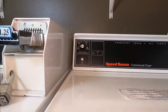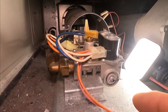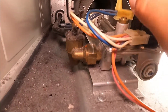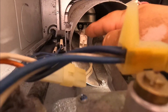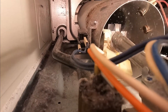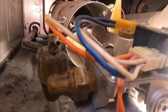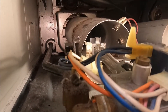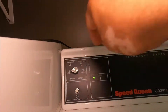Let's go through the sequence of operation. You're going to hear two clicks when we push the start button. The first click is this solenoid gas valve allowing power through to the igniter. Once the igniter gets red hot, the sensor senses that it's hot, and then through these blue wires it's going to open the gas valve. Gas comes out, it fires up, and once it satisfies the temperature it turns off. The cycle goes on and off until your clothes are dry.